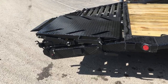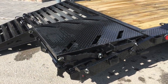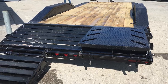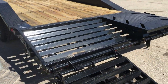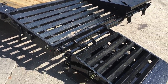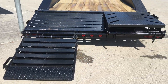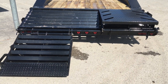Going into the back of the trailer, we've got the optional full-width ramps. We've got one ramp here folded over to show you — it would be a self-cleaning 22-foot deck. Something like this, you're going to get a little over 3 feet of beaver tail. So on a 22-footer, you've got a little bit less than 19 feet of flat deck. Here's one of your ramps folded out. These particular ramps go pretty much to the full width of the unit on a 7-wide. On a 102, you do have a little bit of a gap.